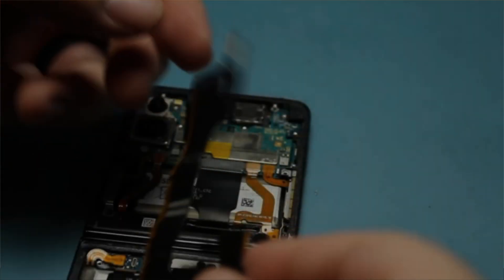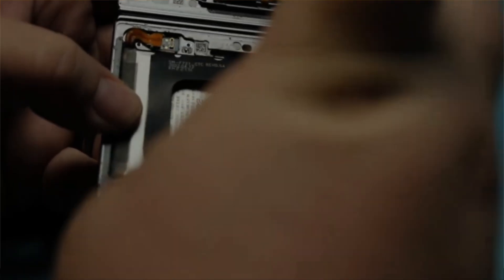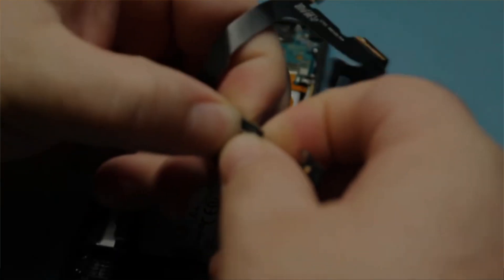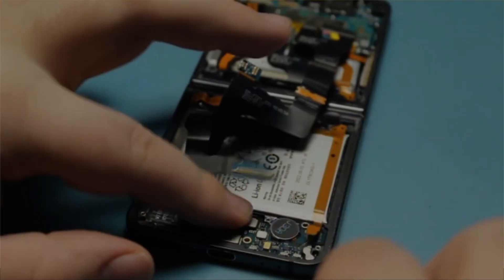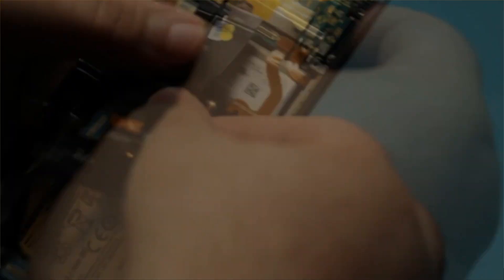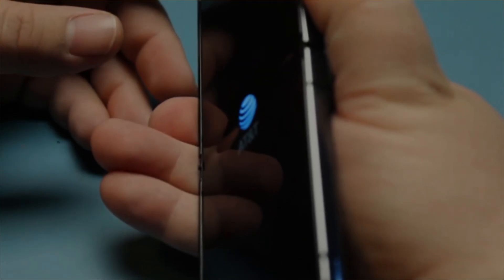If you're experiencing a blackout issue, make sure you've determined whether it's a problem with the magnets and sensors or an issue with the internal flex cable. There's a detailed video showing how to replace the flex cables behind the displays inside the hinge on these models - it's a complicated procedure but might be why your phone is blacking out. If you had a working phone and moved to a completely new screen with a new frame, it's most likely a calibration issue and the screen is not defective. But if the phone suddenly blacked out and the screen turns on but blacks out when you start to close it, it's probably the flex cable and not a hall sensor issue.